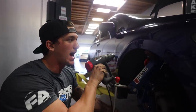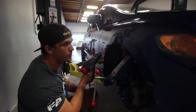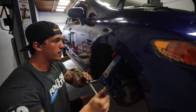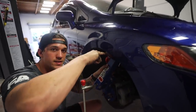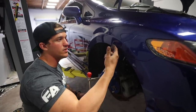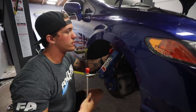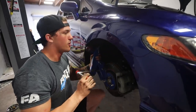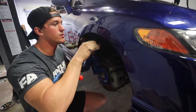One thing that we need to do that I absolutely hate doing is rolling fenders. Pretty much all of my wheels are super aggressive. I've had to roll all of the fenders on pretty much all of my cars. But with this one specifically, this car has crazy fender liner, and it has tabs on the inside, which I had to take off the fender liner, go in and cut all the tabs off, because when you roll the fenders on a Civic, it leaves indents if you don't cut those tabs. One thing I have to be very careful about while rolling these fenders is not getting the bumps on the outside of the fender, which are very, very common when rolling Civic fenders. So my goal right now is to try my best not to get those indents.